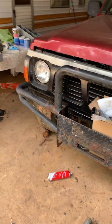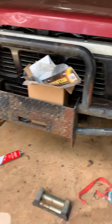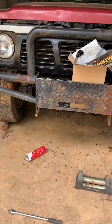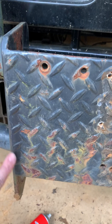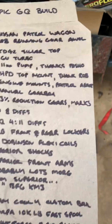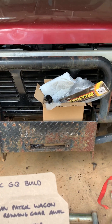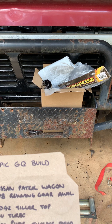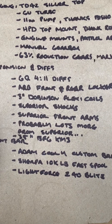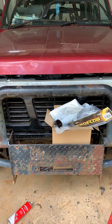For the front bar, it's an Adam Cooley custom bar that was on my mate's car — he's done with his Patrol for now. I'm going to do a few mods: remove those tow points down there because they hurt the approach angle, and put some new ones in line with the chassis. I've got a Sherpa 10,000 pound passable low mount winch going in here. I could go high mount but the Sherpa winch is about half the cost of a standard high mount.